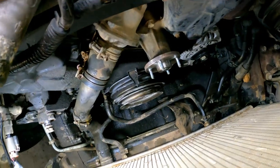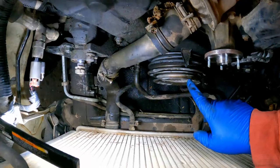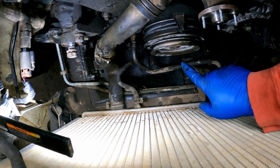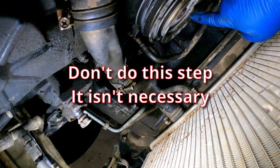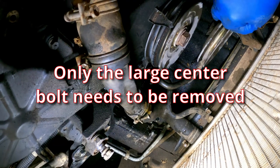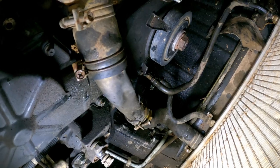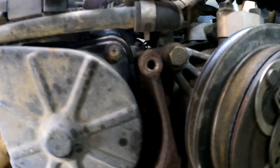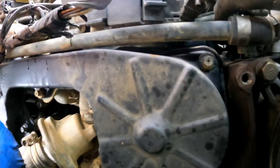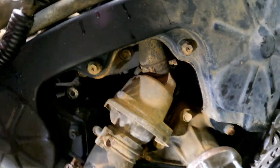All right, while our coolant is draining mostly on the floor, I thought I might show you the front pulleys, or the crankshaft pulleys. There are six or five or something 10 millimeter bolts in there, short ones. You pull those out, and once you do that, you can pull this whole thing off the front. Like so. Now the only thing really stopping us at this point is going to be around this timing cover. All of these bolts, and there are several of them, they go all the way around this thing. You just basically see a bolt, take out a bolt.